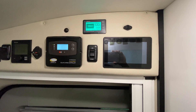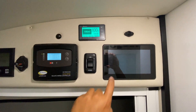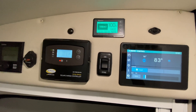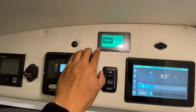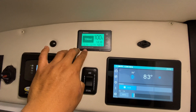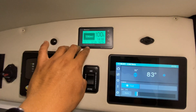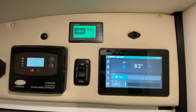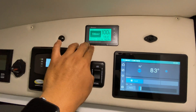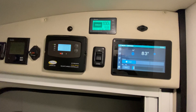With 600 amp hour lithium batteries, you might need a better battery monitor. I went with the Renogy battery monitor — it works really well. It can tell you the draw, the charge stage, and how many amps are going in. It's really nice and helpful. I advise having this installed at the same time as your lithium batteries.